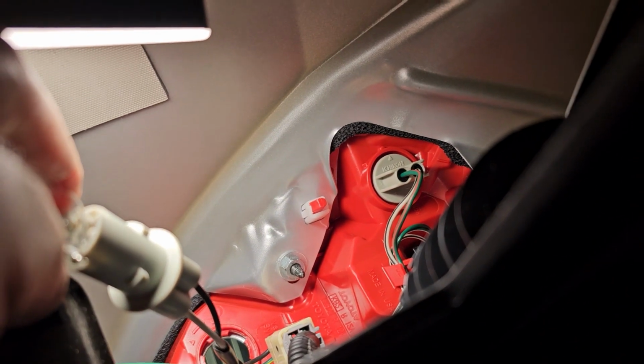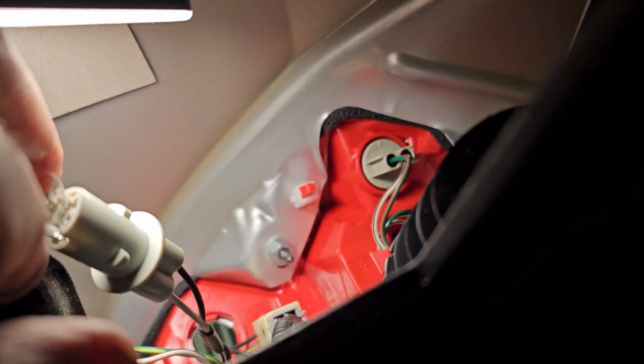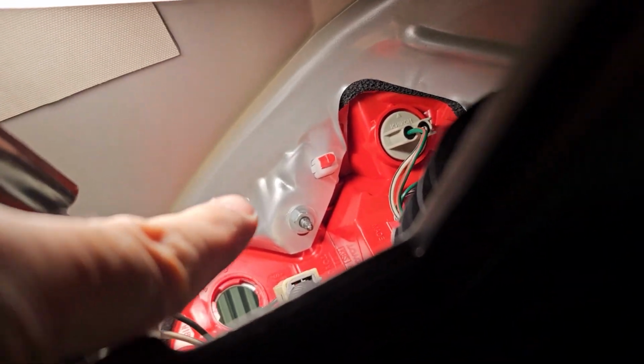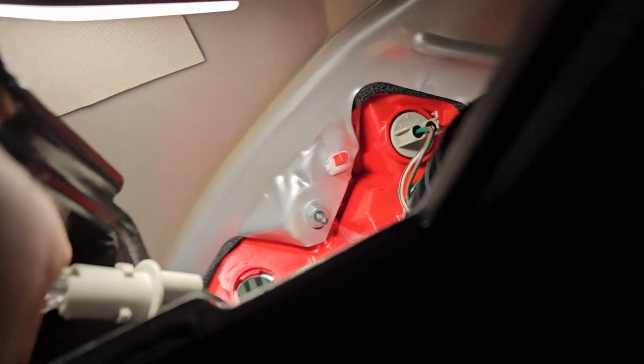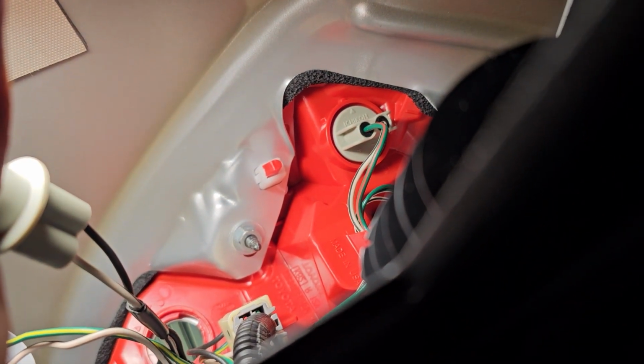This is the spot where the back light is attached. There are two options. Either I can remove that screw and try to remove the rear light, or I have easily pulled out the bulb holder, and now what I'm trying to do, I will terminate these connections from here and will install the antenna cable, and that would seem to be a viable solution for me.